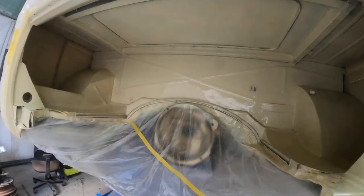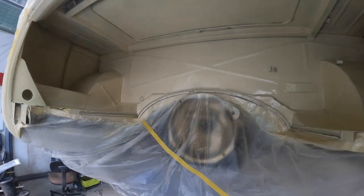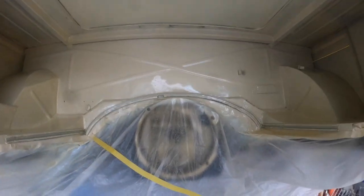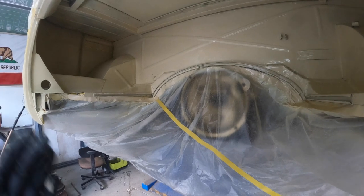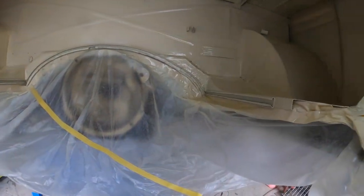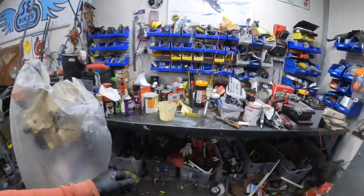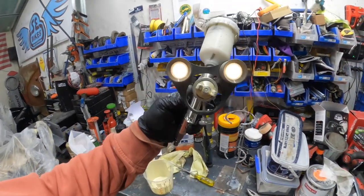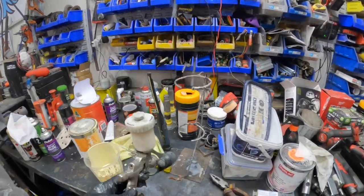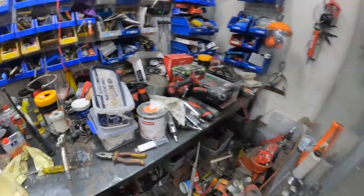Let's have a look. Very difficult spot to paint actually. There's a bit of junk just sitting there, but that's a lot better than it was — the whole top wasn't even painted. I'm just going to let that flash a bit more and give it another go because it's a little bit patchy in a few spots. Painting upside down is bloody difficult. I think I'm going to have to get myself a siphon gun because that gun I've got does not work well at all. I'll give it about 10 minutes and give it another coat.